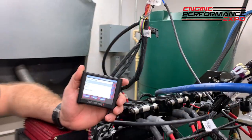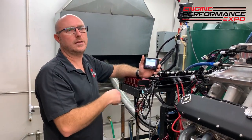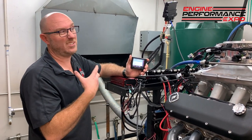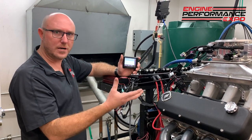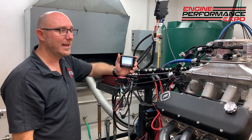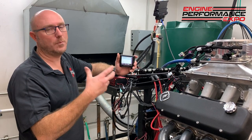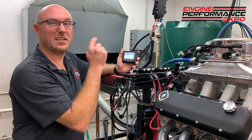Remember, if you had a carburetor and you had an old reliable engine that's been running and you decide, you know what, everybody's doing all the cool stuff these days, I wanna add boost, you're gonna have to send that carburetor out and get all that recalibration work done, set it up for pressurization if you're doing blow through or draw through. There's a lot of work that goes into making a carburetor work. And honestly, a lot of guys run into trouble with ring seal from the tune up not being right, all those other problems. Here, it's literally click a button.